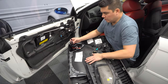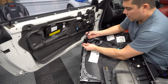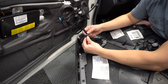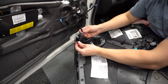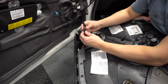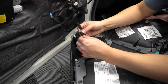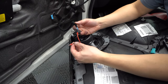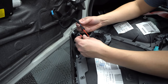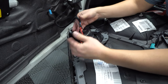We're ready to put the door panel back on, so let me explain the wiring on this one. The Bob Sound has one black and red and one red. The factory has a blue and white and a blue and brown. Comparing with the old speaker, the red from the Bob Sound gets plugged into the blue and white side. The black and red Bob Sound gets plugged into the blue and brown. Now that's good to go.